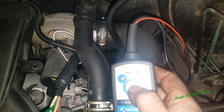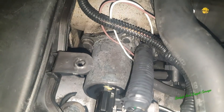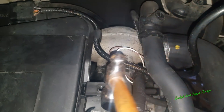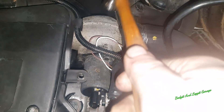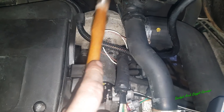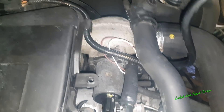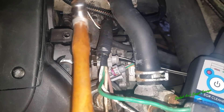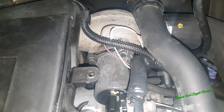The machine has now stopped. Let's just activate it again. That is now activating and again just absolutely nothing. What we can try is just give it a few love taps. The EGR valve isn't clicking away but the machine is. You don't want to hit it hard but it can sometimes help. Absolutely nothing — it was trying at the beginning, and after that it's just completely shot.